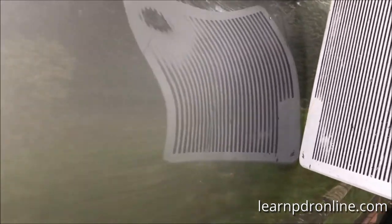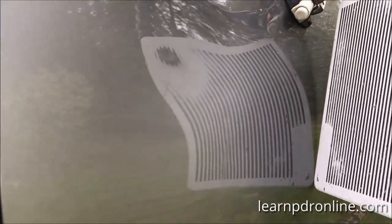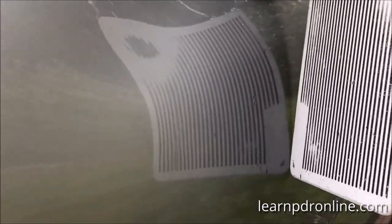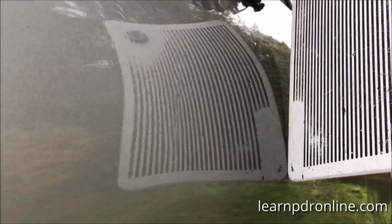I've given that quite a few pulls now and a lot of tapping around. You can see I've just got this slight little crease right in the middle there, but overall I think it's coming out really well. I have gone from the inside a couple of times using a standard door hook bar, which I find just a bit easier to get a bit of precision. So I'm going to go in from the inside and just pick out some of these lows.